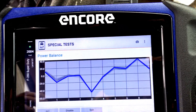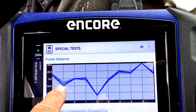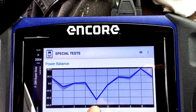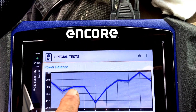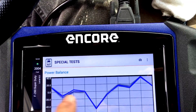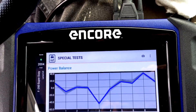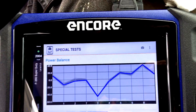They hang for quite a period of time so you can see when something dropped out. You can see number one is dropped down anywhere from 10 to 15 percent below. Three is at 45 percent or so. And two and seven and four are all right around what you'd call a zero line. Then five, six, and eight are all trying to compensate for the RPM change. So there you go - a nice view into the workings of the motor.